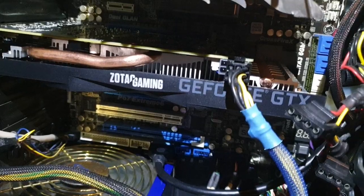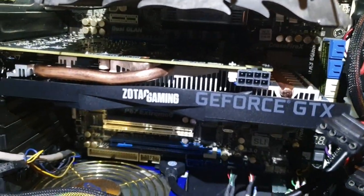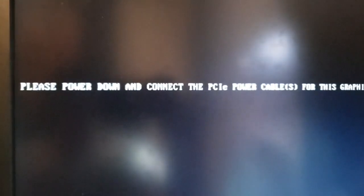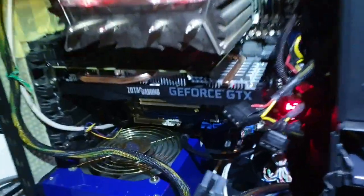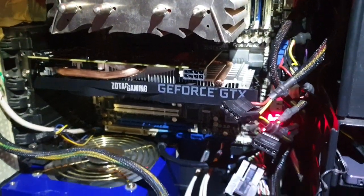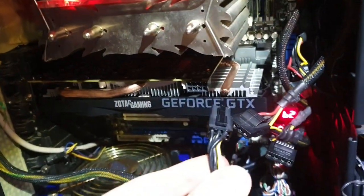When I tried to turn it on, I got this error message — which seems familiar. I also noticed that even if the plug is removed, so the card is powered just by the motherboard and not by the power supply connector, I got the same message. This hasn't happened before. In my previous experience, when you remove the power connector, the computer just gives an error that the video card is not recognized — no video card message — and you don't get this one. At least now there is some improvement and you can actually see that you don't have power.